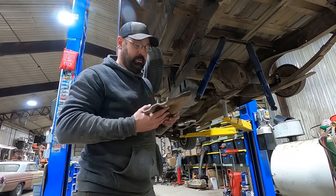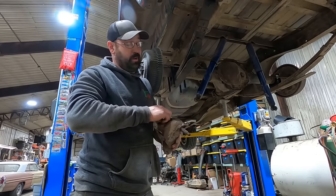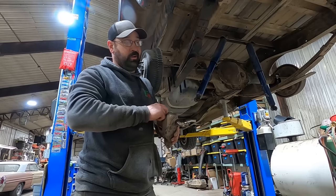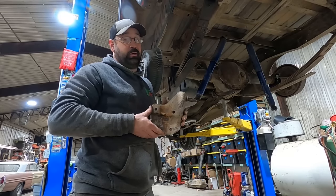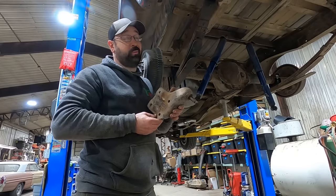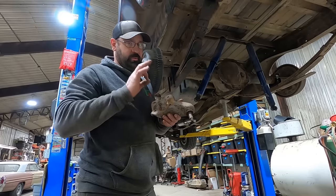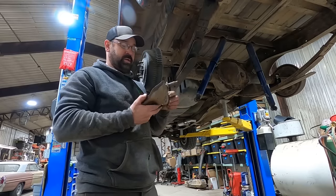My favorite tool. The old reamer. Those things are handy. Reamers by Norseman. Not a paid promotion, not a paid sponsor, not an affiliate. They just make a dang good product. They're so much better than a standard drill. They make good drill bits, but drill bits want to bite when you're doing stuff. Tapered reamers. Cat's pajamas.